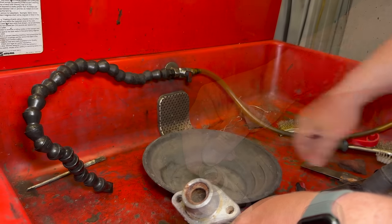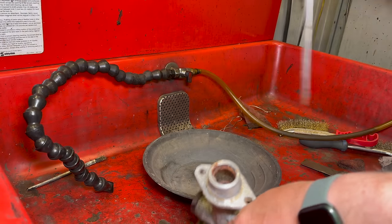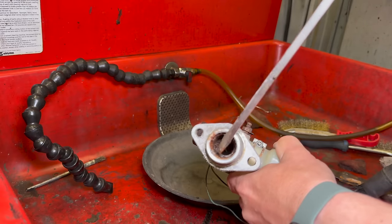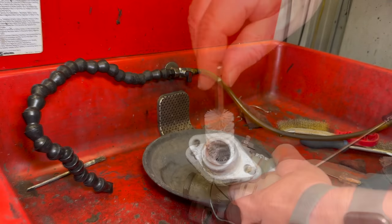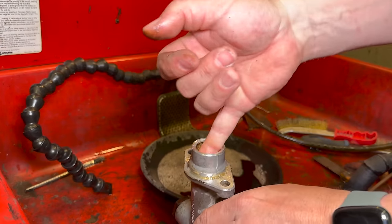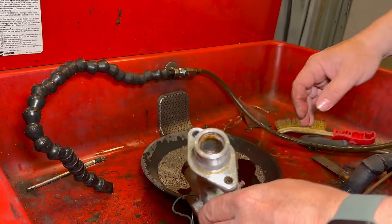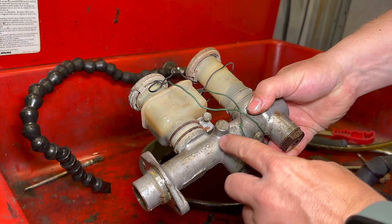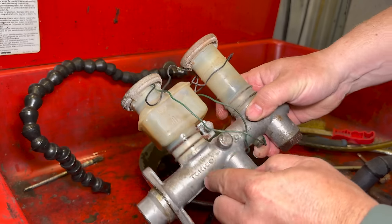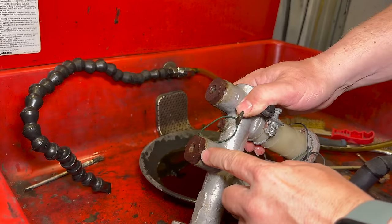The clip is out. This washer stops the piston from falling out the back of the master cylinder. The cylinder in there is totally stuck, so I'm going to try to wash this out and get it nice and clean inside, maybe use a little brush to clean that up. The bore inside there doesn't feel that bad, but I will need to try to get this piston to pop back up and out of there so I can get everything fully cleaned out. To push the piston back out, I'm going to have to see if I can get access — either take off these plugs or take off the reservoirs and see if I can see the back of the piston so that I can push it back out. Looks like taking off one of the plugs might be the easiest.